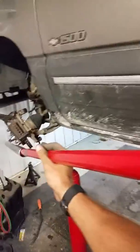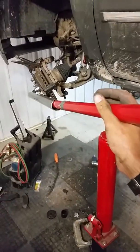I'd say you start with a breaker bar and work your way out — by that I mean I added a bar to increase the length for extra leverage, and then got an even longer piece from a jack and threw that in there. I couldn't actually crank this thing until I had about four to five feet of length.